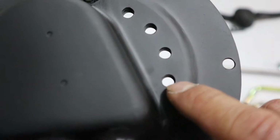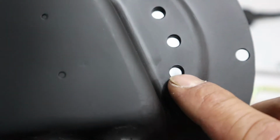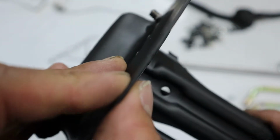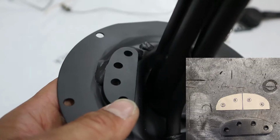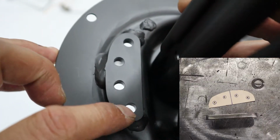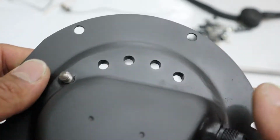And also the depth of this material has to be between 0.262 of an inch to 0.322 of an inch, or roughly just about 17/64 to 5/16 deep. And obviously, if you look at this material here, it's actually not very thick at all. So I had to build that material up to the requirement. So what I did was I took a 1/4 inch flat bar and I cut it down, ran off the unnecessary amount of metal here, but I drilled the holes exactly where the factory holes were, and I lined that up, right?